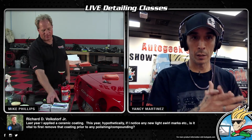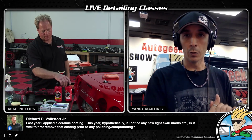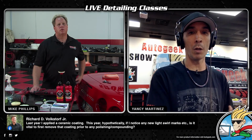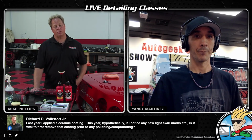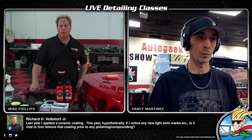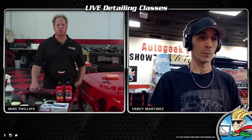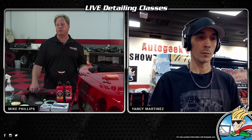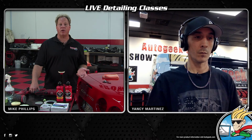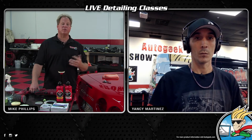We have Richard back here again. Last year, I applied a ceramic coating. This year, hypothetically, if I notice any new light swirl marks, is it vital to first remove that coating prior to any polishing or compounding? Well, when you polish or compound, you will remove the coating. The coating that was on here was really stout. I buffed out most of this car with 3D1, which is a compound polish. It's not super aggressive, but for the coating areas, I ended up using Pinnacle Advanced Compound with a wool pad on a Rupes Nano.